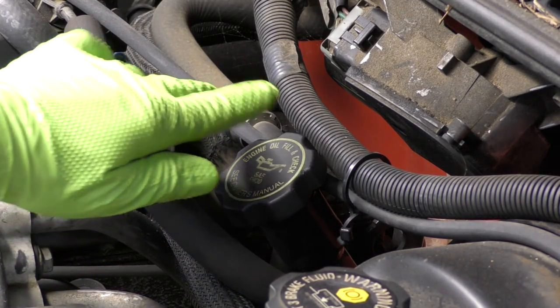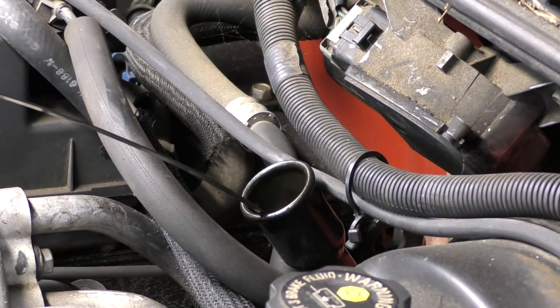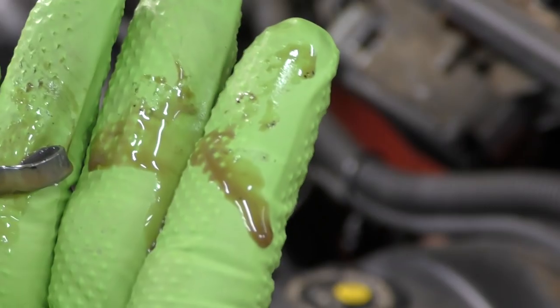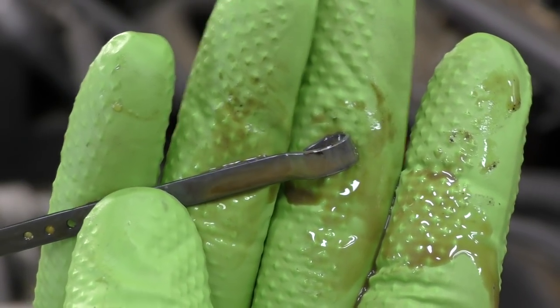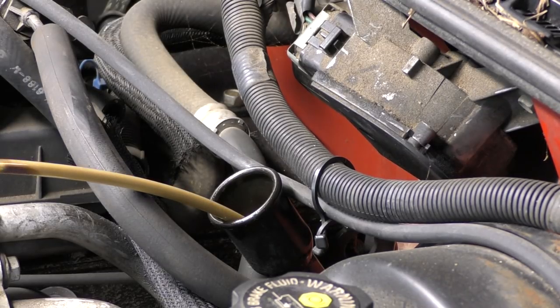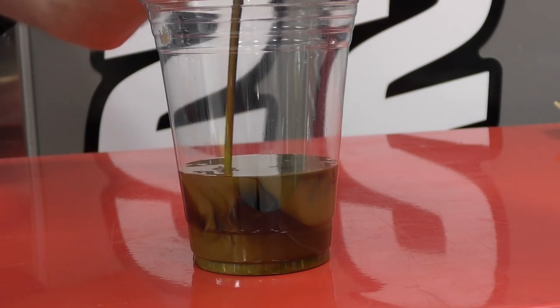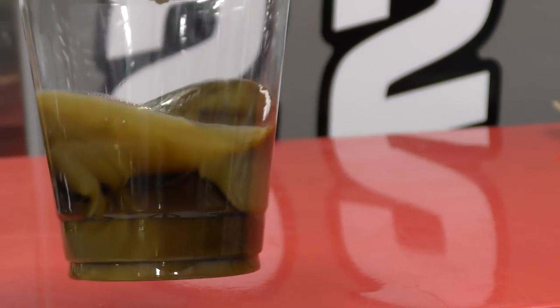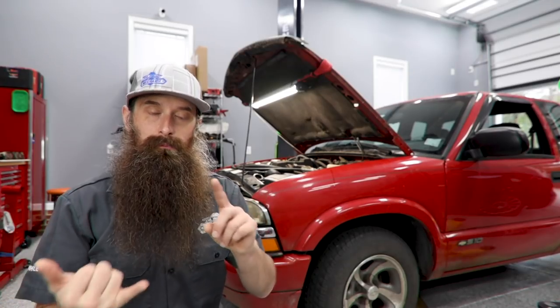Let's check our engine oil next and see what it looks like. Oftentimes, when coolant and engine oil are mixed together, the oil gets this milkshake type of consistency and color. And unfortunately, that's kind of what we're looking at here. It's very watery, thin, and look at how white that is right there. Not awesome at all. Let's pull a bigger sample of this oil so we can do a better job examining it. Not only does it stink, but that's milkshake-y goodness. That is very much the chocolate milkshake syndrome. As bad as this looks after pouring it into the cup, it's actually worse than that — there's probably a little bit of regular oil at the bottom of the extractor, so this is really, really bad. We got nasty oil, we got low coolant, we got nasty coolant, we're getting white smoke, and the car's overheating. All pretty much signs of a failing head gasket.